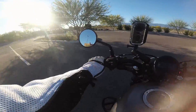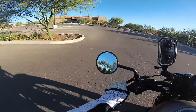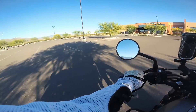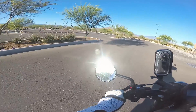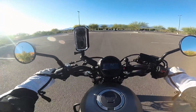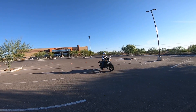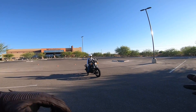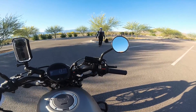Remember to keep those handlebars straight. We should have put T-Rex sliders on today. Just keep them straight and you won't have to worry about sliders. So pulling the clutch now — apply the brakes, squeeze, squeeze, harder, harder, harder. You see how at the very end it kind of went down and up? So now when you feel that weight transfer to the front, really squeeze that front brake. Go ahead and do it again.